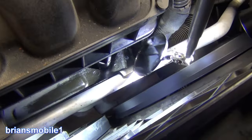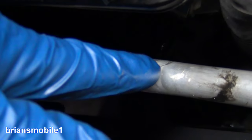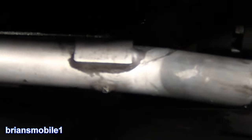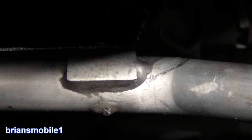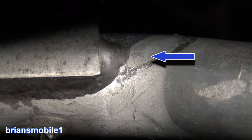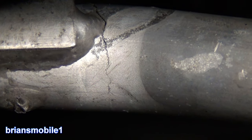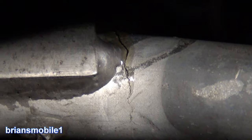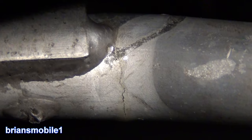If you see fluid on top of that bracket here for your intake support, you'll notice where it's welded on — these get cracked. Because when you weld aluminum and then you bend it this close to a weld, it creates a weakness. And if you look closely, you can see the crack on the right hand side right there. There's a little bit of a crack, and if I flex the line, see if I can get that thing to show up a little better. Isn't that crazy? Look at that — it's just cracked that whole way.